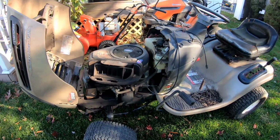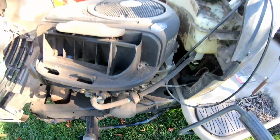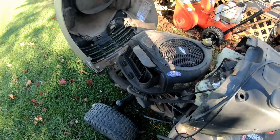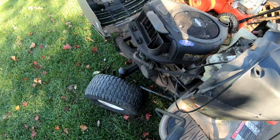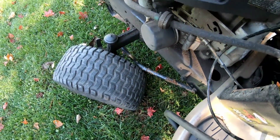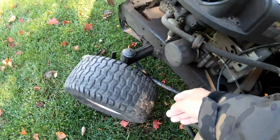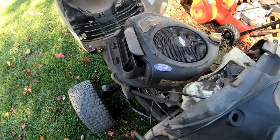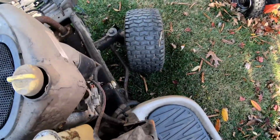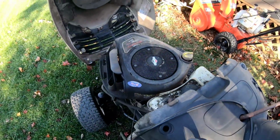And so he said the linkages were kind of reversed or something like that. That drag link looks a little weird. But it looks okay. Well, see how that touches? It's not supposed to touch, so I think he reversed it. This bump here is supposed to be on the bottom. That looks like it turns, up to when it hits that thing, see? So you just have to reverse the linkage.